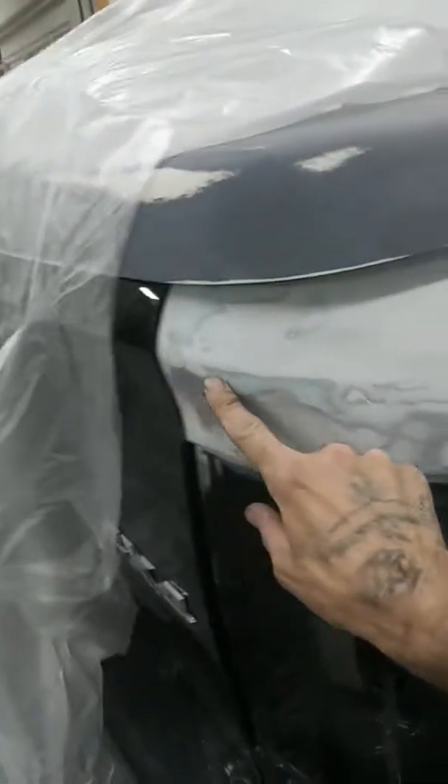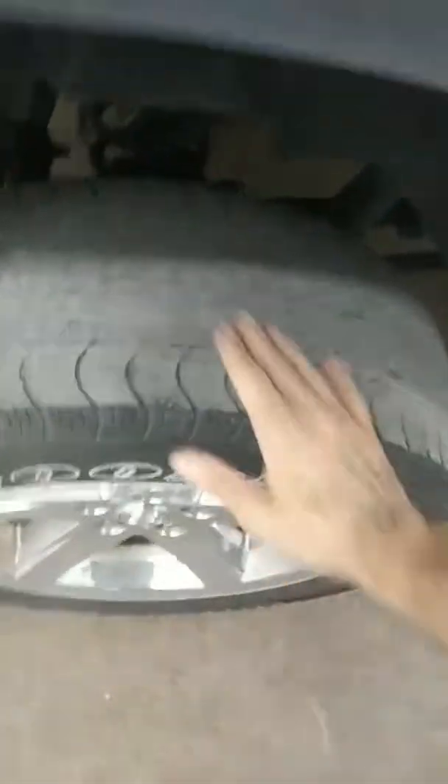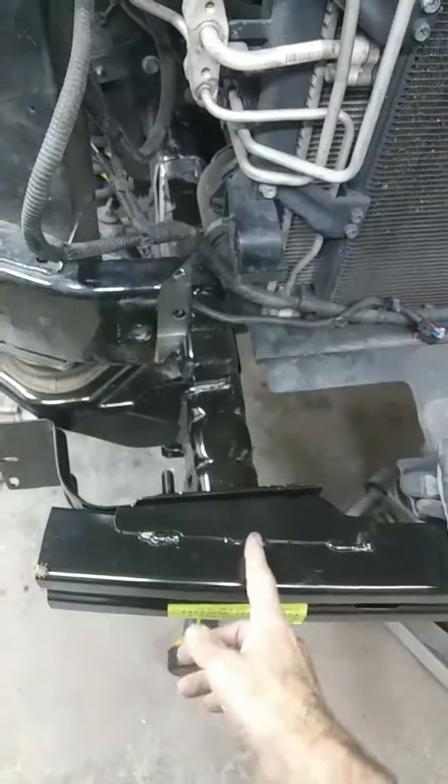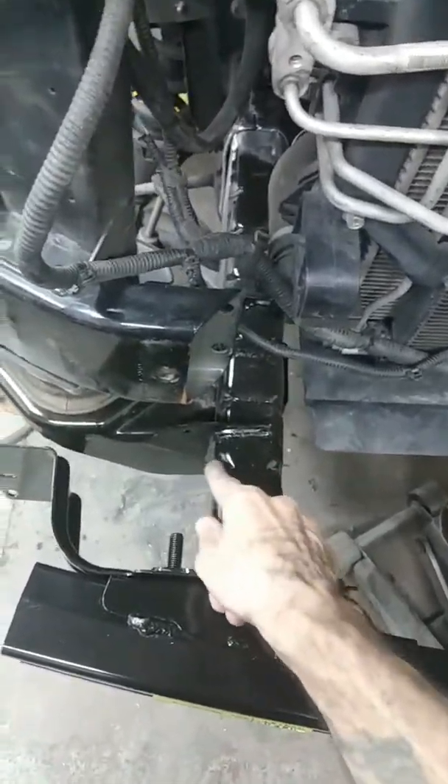I wanted to show you this — it's the one I cut that piece out of the bed, straightened it up and put it back in. A couple little dings to sand, then it just gets primer and filler. But yeah, it definitely needs tires — chunks of rubber out of them and they're basically slick. There are also dents on the roof. This here is part of the structure of the truck, and this was pushed in from the rad support. It got hit right here on the frame horn — you can see it was bent back and it wrinkled up at these crush lanes.